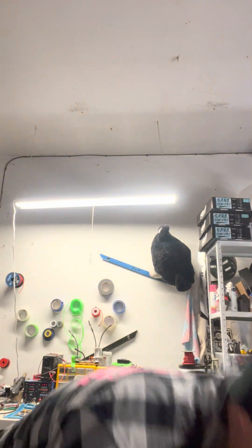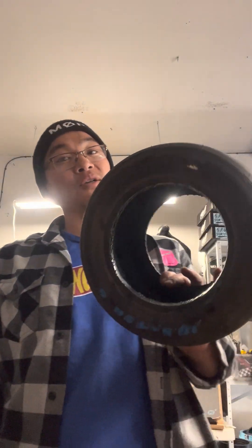If you use a strap and lubricate the inner lip and the inner part of the tire appropriately, you can get most of these tires on with the allotted pressure. I get tires on with about 35–40 PSI — both sides, Vega, Unilis, whatever it is. If you have the right tools you have less of a chance of messing your stuff up. That's my TED talk.